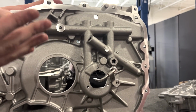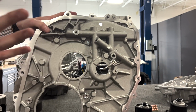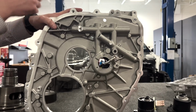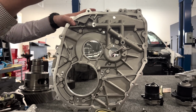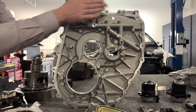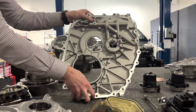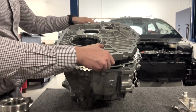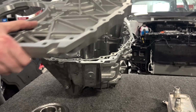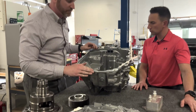Actually, most of it I think was as cast, and then they essentially had a plate that bolted on. Granted, we don't like fasteners, but in some ways, maybe in another iteration, you could end up with something more of a manifold setup, similar to an automatic transmission valve body, and try and get some of the oiling path complexities out. And then this would essentially load in as an entire assembly with the gear train onto the motor stator assembly itself.